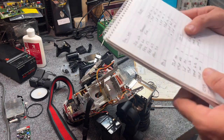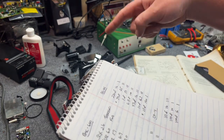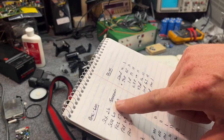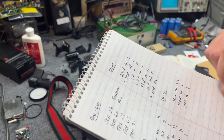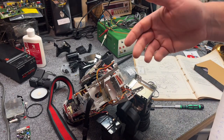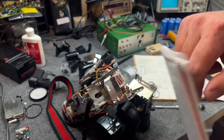The other belts you'll need: the forward belt — the take-up reel belt — should be an SCQ 6.0, and that's on the tape door side. The threading belt is an SCX 2.6. If you hit eject and it doesn't unthread, or you hear a whirring but nothing happens, that's all controlled by that SCX 2.6 threading belt.